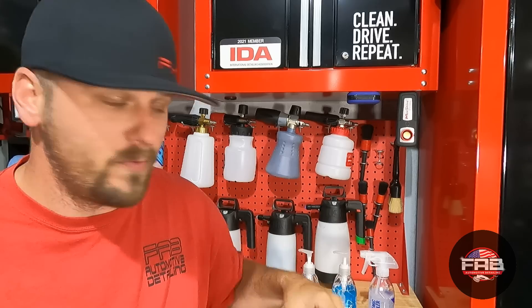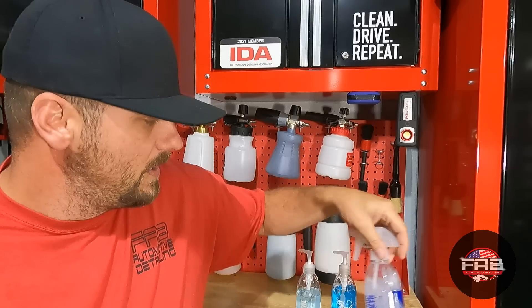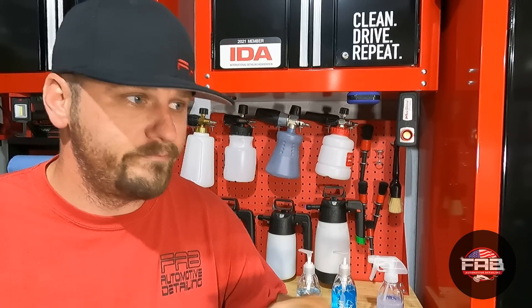To dry, you never dry without a drying aid. I'll make sure I show you guys the hydrophobics before I dry so you can see what it looks like, then we'll use the Q-Twin Ceramic Detailer — keeping it in the same product family as the coating. I'll spray it on the surface, spread it, use my Gyeon drying towel, and wipe it up. Most of this video will probably be done in voiceover because it is so windy out here — it's fall in Indiana, leaves are falling.